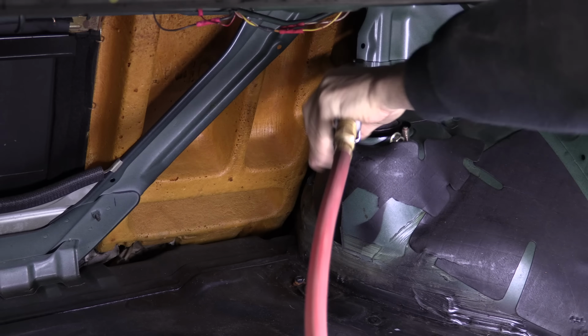They were stuck so good, I basically had to reclamp the vice grips every 60 degrees to be able to continue turning each one. I had to work them back and forth and lap the threads with the rust and penetrating oil slurry that was trapped in there to avoid ripping those threads out. There went another hour.